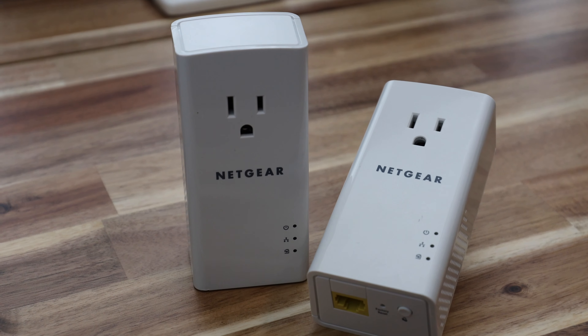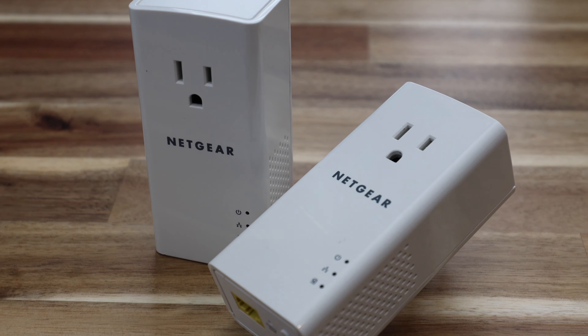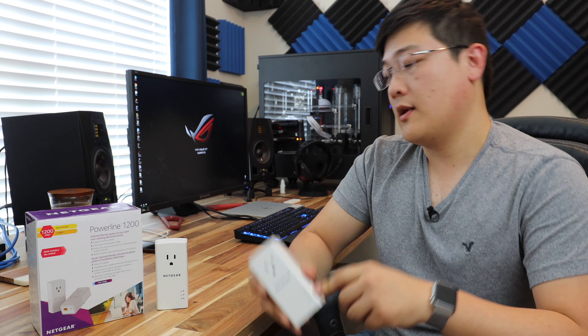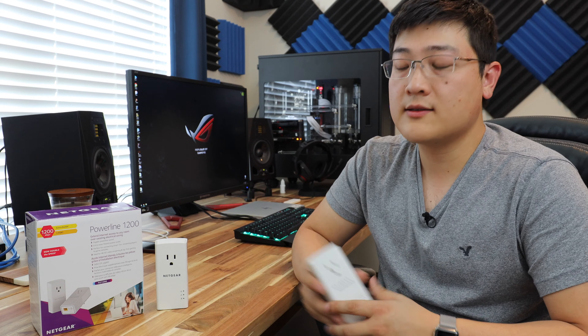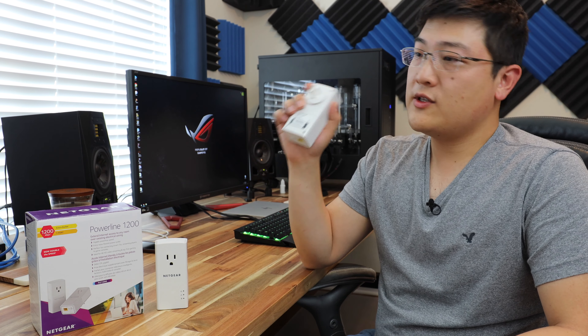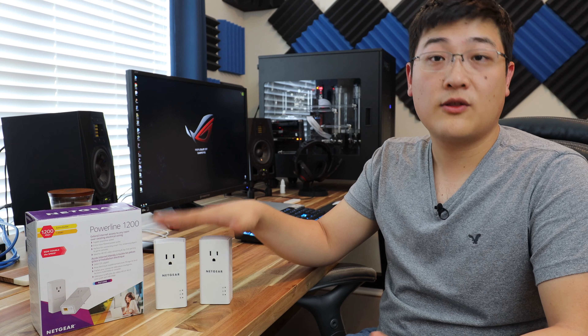On the front there are three LEDs. The first is the power LED. The second indicates a network device is plugged in — it'll be green if something's connected. The third LED is the signal strength through the power line. Because power line signals can lose strength through walls and every house is different, it tells you the signal quality. Green means more than 80 megabits per second, amber means less than 80 megabits, and red means below 50 megabits per second. You can go throughout your house and plug this device in to pick the best sockets for your devices.